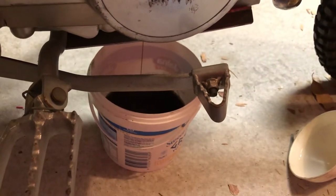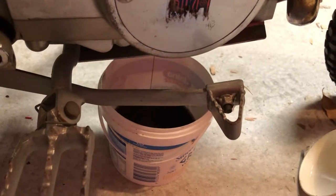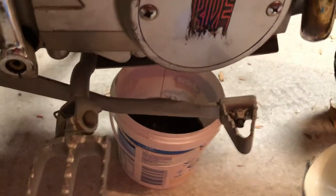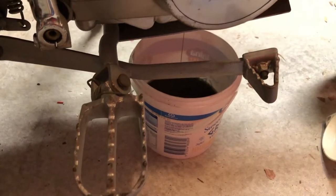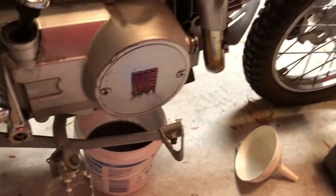That's not a great indicator, because if you get that into your valves and obviously all your bearings and whatnot, they're really not getting lubricated as well. Ideally you want to let this drain as long as potentially possible. The other thing you'll get from draining it is an idea of how much to put back in.